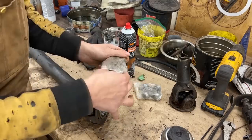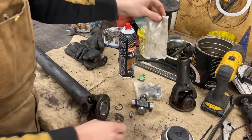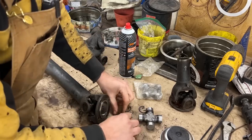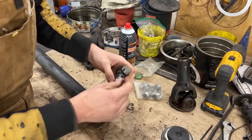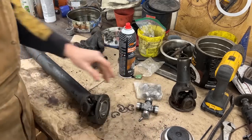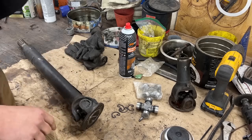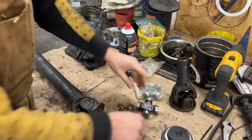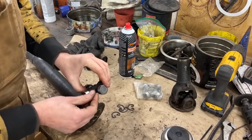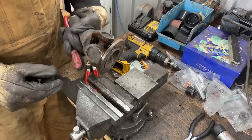We have here 2 new U-joints. They come with the 4 circlips and the grease nipple. What's important here is to remove the grease nipple before you start taking it apart. Otherwise, you can't take it out. And when you're installing it, of course, the same way. You install the grease nipple last, after everything is assembled. All right,